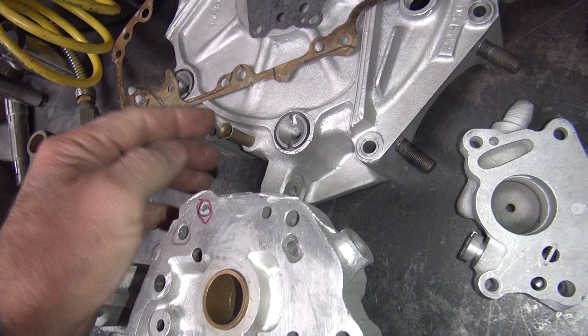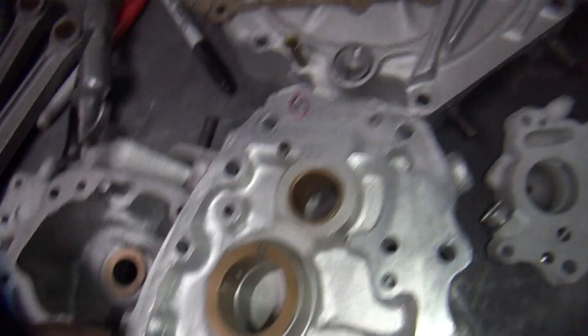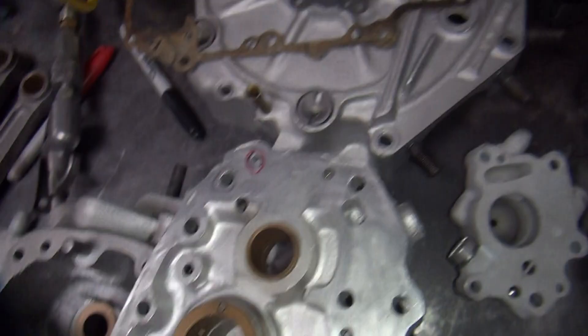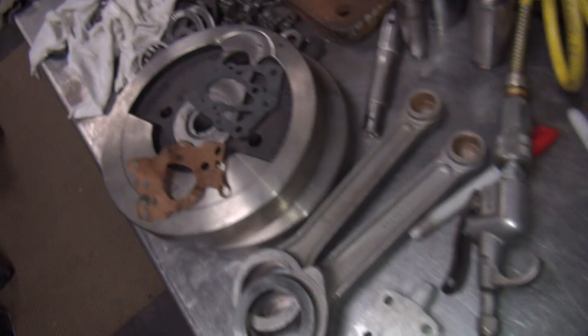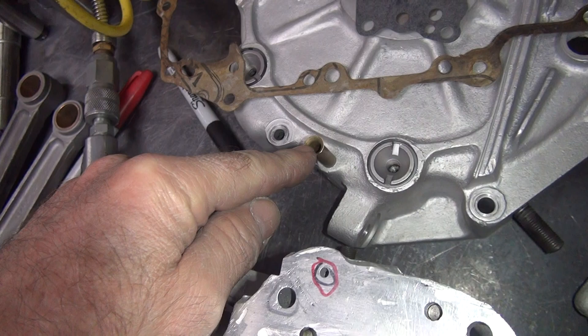So it's in the breather, it's in the crankcase pressure here. Because you're inside the crankcase pressure here, these holes are connected — that hole goes over here. It comes through the oil pump pressure, which feeds oil into this gallery here, once it goes past that tapered screw. Basically it drips oil into the line that goes across and whatever little crankcase pressure you built up inside your crank cover area here, your gear case pressure automatically blows through out of here.